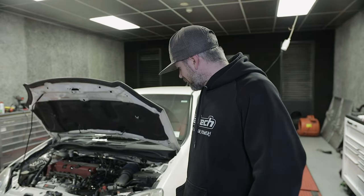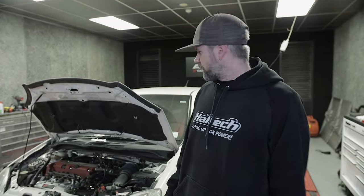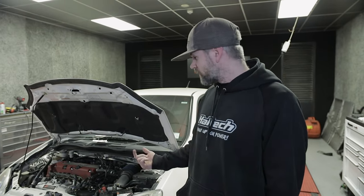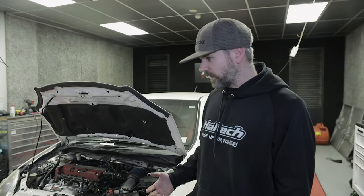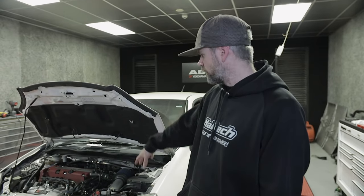I'm going to say something, I don't know how to say it without being offensive, but Link, I don't know if this is because I'm wearing a Haltech jumper or something like that, but the Link that's in this is not playing game. The reason why we picked it is because the last EP3 we did, we put a Haltech Elite 1500 in it, and apparently we found out after we fitted it, it didn't have the serial hardware on the board, so none of the stuff like the AC or the coolant temp gauge worked.